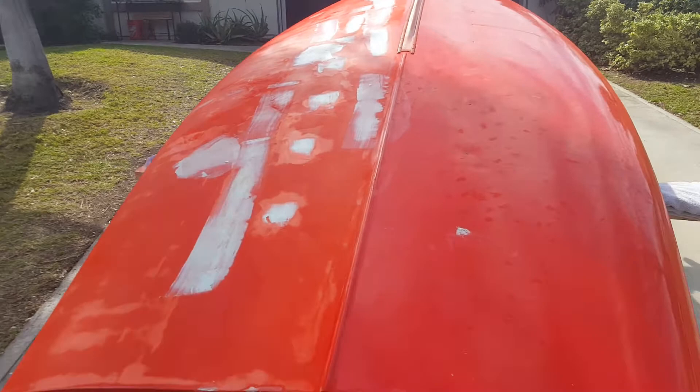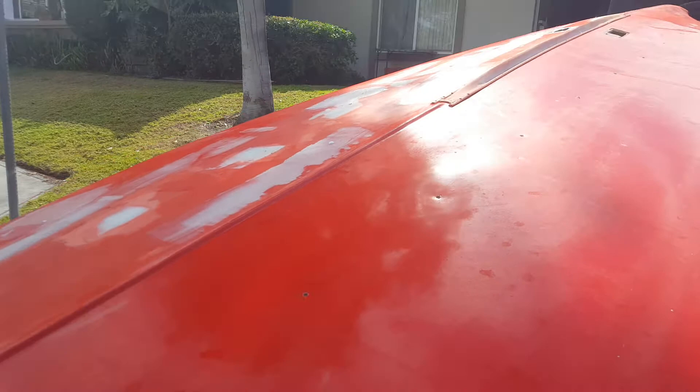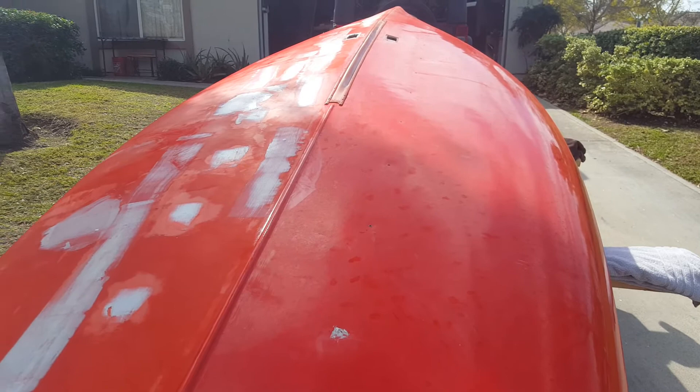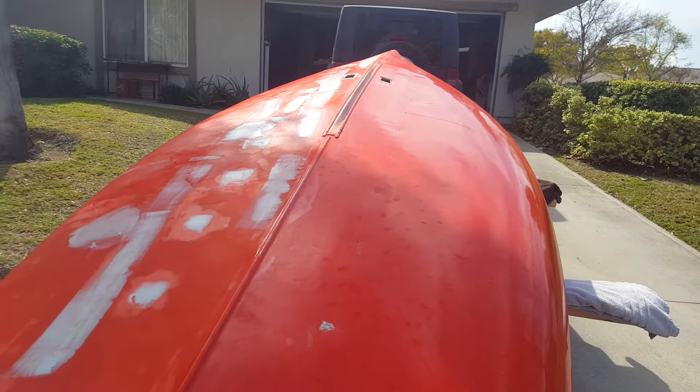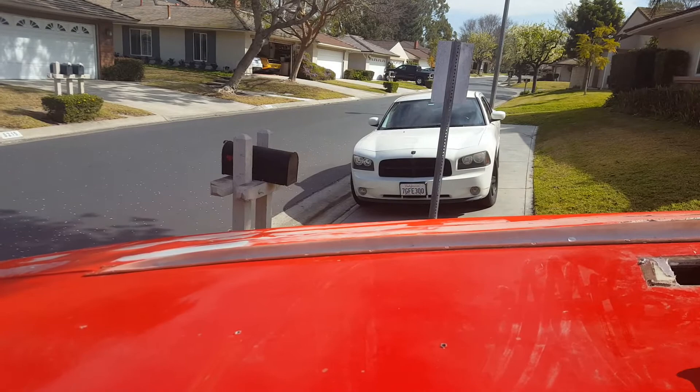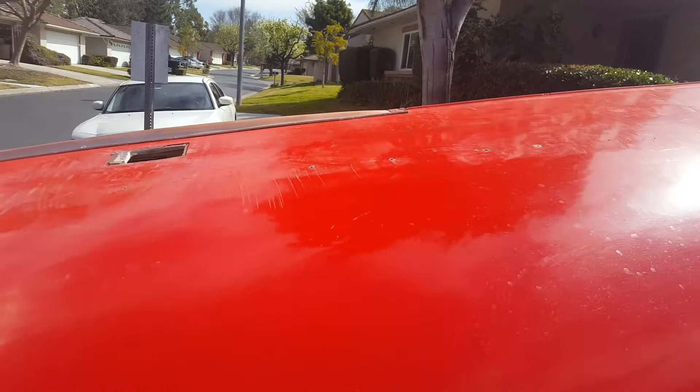You can see on this side — this is what I'll be doing this afternoon — I still have a few holes left in here. Eleven on each side from where I bolted down the wooden strips inside for the new stringers. It worked a lot better to bolt them down, epoxy them in place, and then remove the bolts. I'll fill those up, and I also have a pretty major area up here with depressions of about an eighth to a quarter inch that I'll be sanding out and filling with fairing compound.